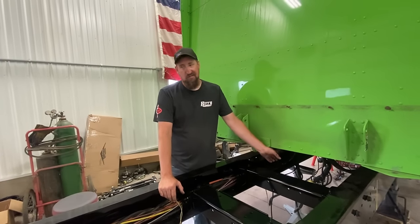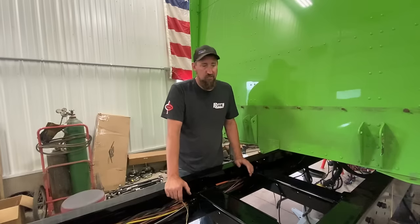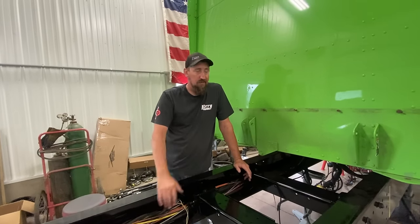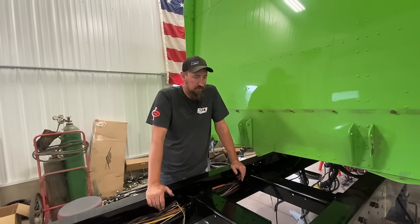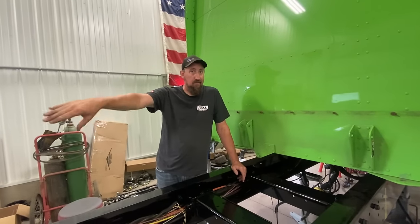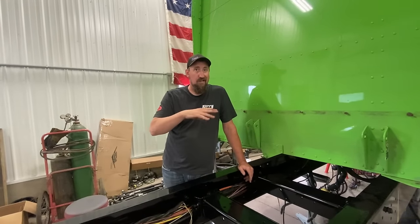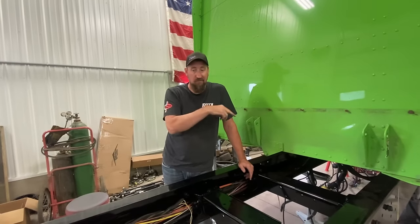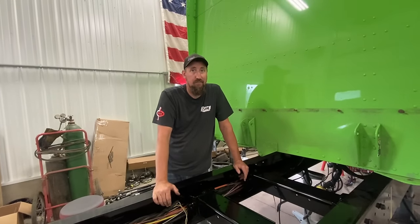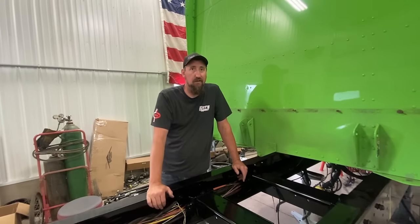But we took every one out and took them to JM Driveline. It's out of Wisconsin by us. Good friend of mine. And he wanted everything because he can balance everything. That way, if you only take two in and there's a few that maybe are out of balance, that's going to make them all fight each other. You don't want that. Makes sense.